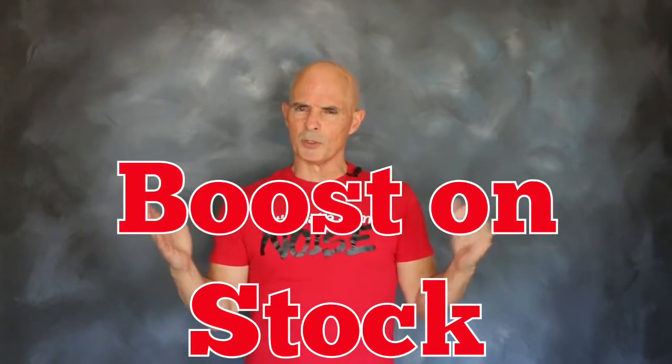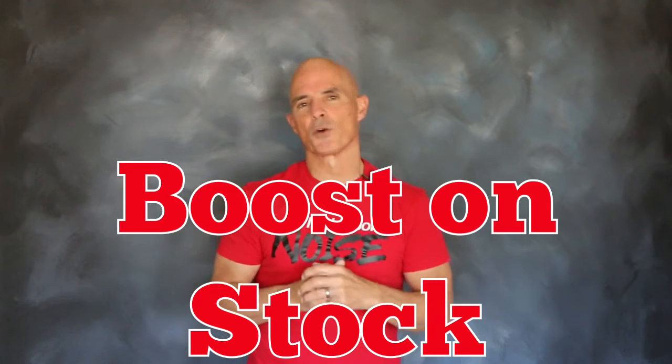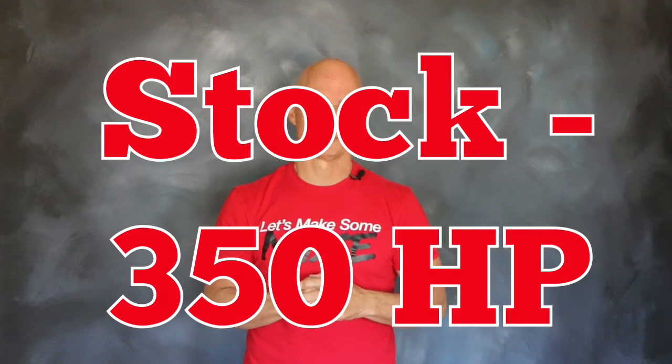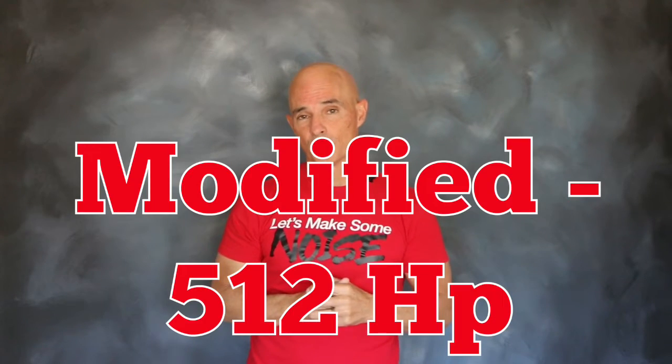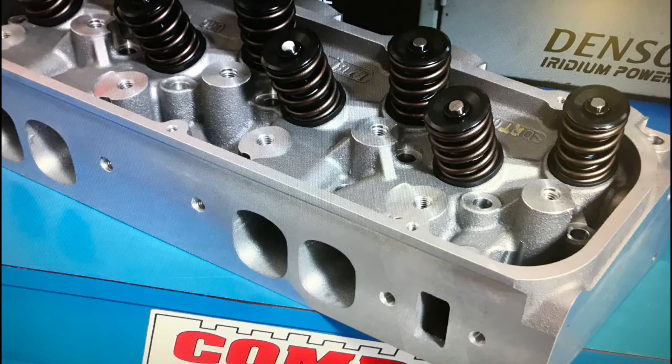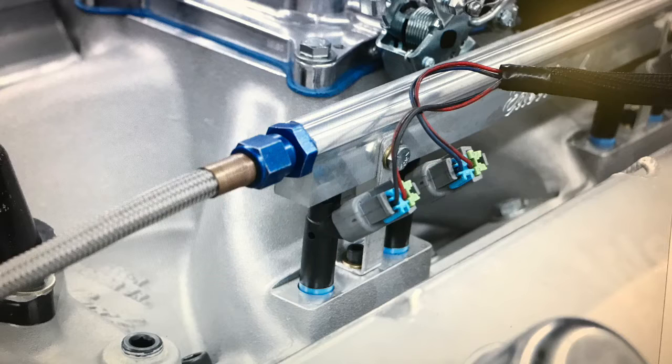Of course it's possible to run boost on a stock Gen 6 454, but it's always better to improve the power output of the naturally aspirated motor before adding boost. You see, run on the dyno in stock trim, a Gen 6 454 makes about 350 horsepower. After the modifications, our motor produced 512 horsepower and 488 foot-pounds of torque. Now, of course, that took a set of as-cast aluminum oval port heads and a single-plane EFI intake.